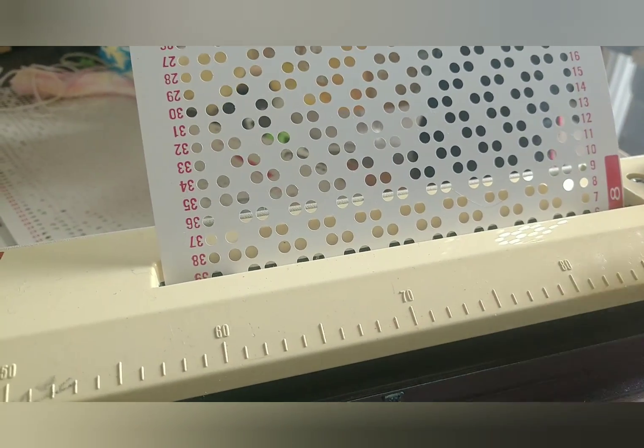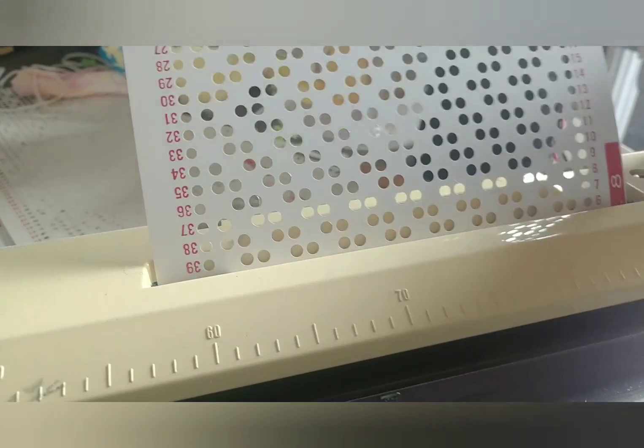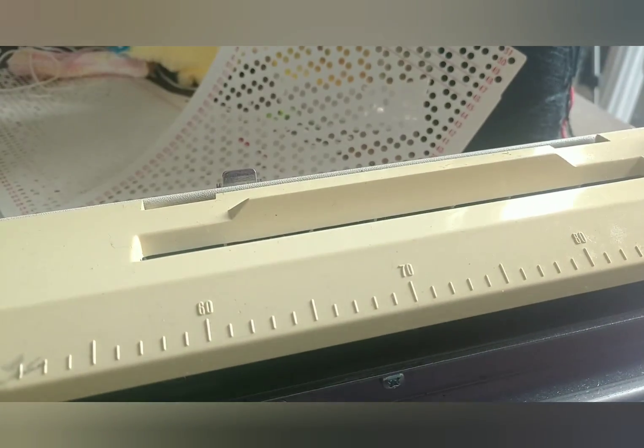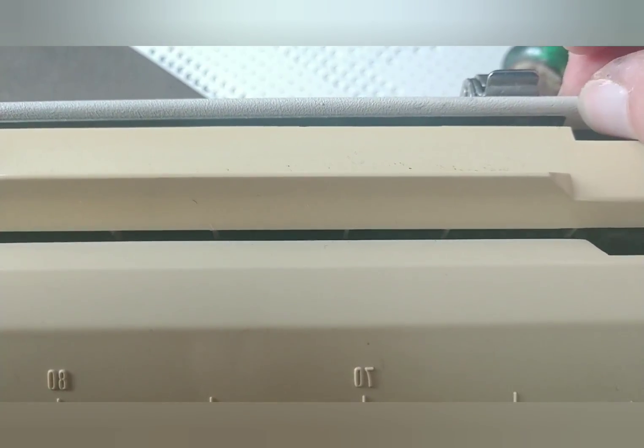Since it rotates fine without a card, and the card doesn't have a flaw, I'm thinking I need to go looking for some kind of impediment, something that has fallen in this slot somehow. We've already been in, fixed the problem, and come out, and I can tell you how to diagnose the problem without going all the way in. Note the little dark area, which is the rear card guide.